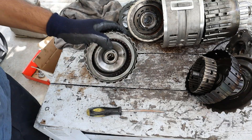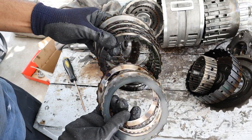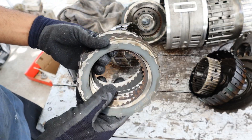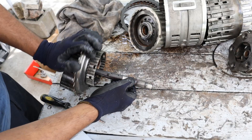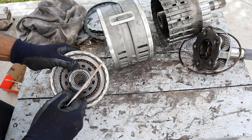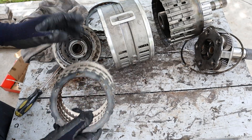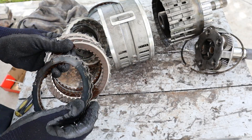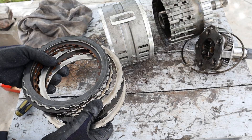Let's take this one apart, which is nestled inside of the last one. Someone send me a new pick set too because this one's almost broken. You can see the piston inside of there. Check out these clutches — they're really worn out, look how dark this is. It should be a brown color. You can even see some burn marks on here — shouldn't be like that. It also smells pretty burnt. The output of the first two sets of clutches goes to this intermediary shaft, which then goes to the next set of clutches. There are holes here that feed the pistons to lock them up. This clutch nestled inside doesn't look too bad on the outside, but wiping my finger on it shows a lot of metal particles stuck to it. The frictions on the inside are looking a lot better — that's how they're supposed to look, nice and brown. The clutch on the outside of that is looking a little bit on the darker side, but not completely burnt up.